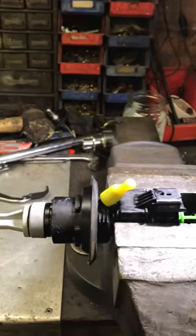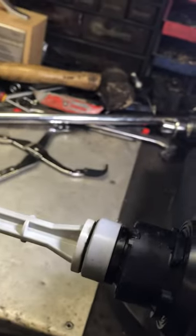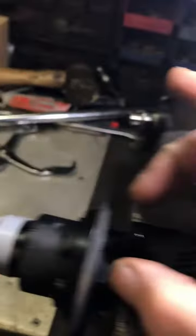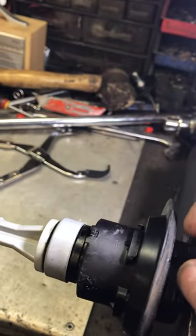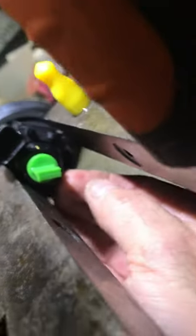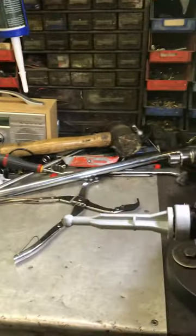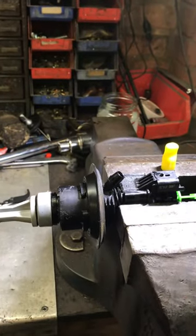Replace the master cylinder and this clip to cure your problem. The feed pipe here is just like a dog tooth, and on the end of your feed pipe there's a little clip which you press together to release the pipe. Press it there — there's a little clip underneath — press that open and pull the pipe out for the pressure pipe to your clutch.